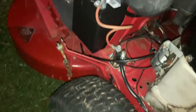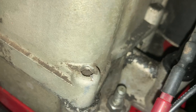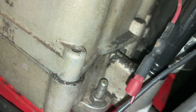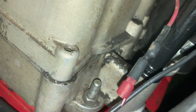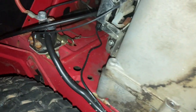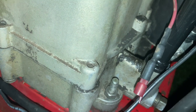The switch works perfectly. One thing I need to mention is the alternator wire — see that right there with the little red piece. It comes out underneath the flywheel. You're supposed to have two wires: one goes to your battery to charge it, and one more wire for the lights to run AC. You're also supposed to have a small voltage regulator — a little square box. This engine doesn't have one, so that's why I have not hooked up the alternator.